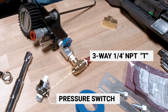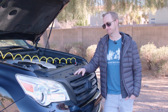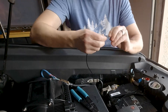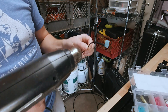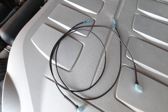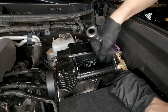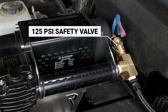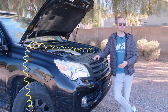Before I moved the pressure switch downstream of the check valve, the compressor would cycle every 30 seconds or so due to air leaking back out through the compressor — super annoying. To relocate the pressure switch, I created a couple of short jumper wires that extend the pressure switch leads, which I originally created in the very first video I did on modifying the Smittybilt. I'll put a link to that video in the description below. Moving the pressure switch also allowed me to add a 125 psi safety valve at the back of the compressor, so that if the pressure switch failed in the on position, the compressor wouldn't essentially become an IED.